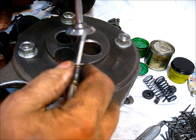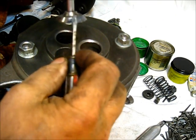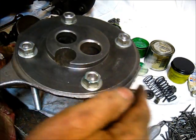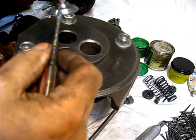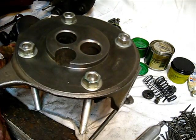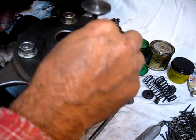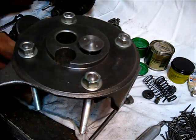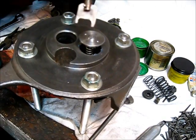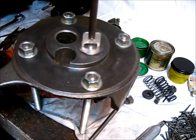Put your little compound on there — very little, super fine compound. If you have to do any more than this, take note. This valve has not made a full revolution in that seat as of yet. It's something to look up in the book. Don't forget the bump spring — put that in there. Affix this thing into the valve and give it one more time.